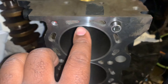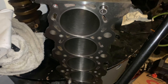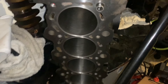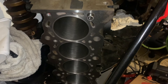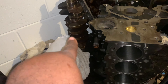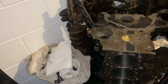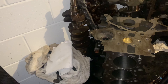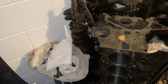I also got my block — this is the 4G93 block. It now has O-rings, so I am boost certified and I can take it to the moon. The block is 100% complete, so the engine build series for this will be coming up soon. It looks really, really good. I had the block resurfaced, so it's nice and sharp, freshly cut. This is the crankshaft right here for this engine. The last thing I have to do is get the crankshaft cleaned up — it'll be micro-polished and 100% balanced.